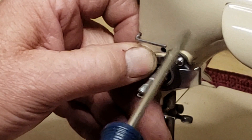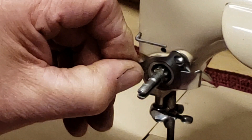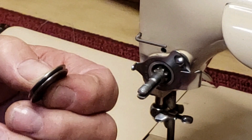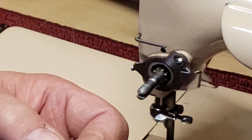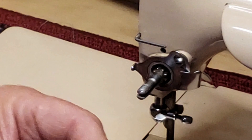Right near the middle of that elongated slot. Next comes that four-piece assembly — your two pressure plates of your tension assembly, the convex sides face each other. And then this plate with the standoffs on it goes over the top of that. And then your check spring — your plates are going to fit right into that space there between the check spring and its outer coil.